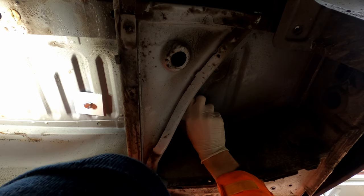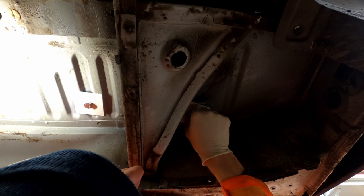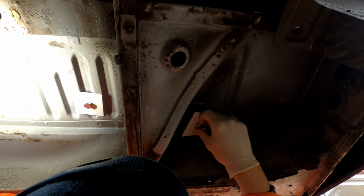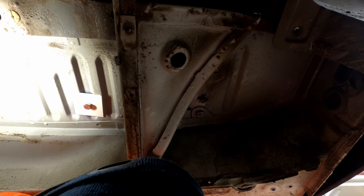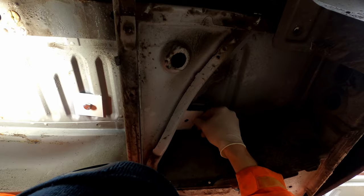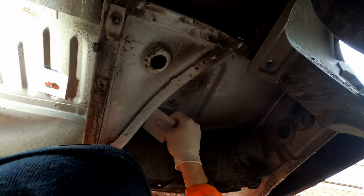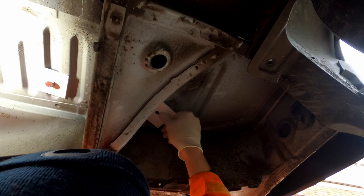So what was he looking for? He was looking for 100 by 100 mil and 4 millimeter thick spreader plates. So you might want to find out with him first before you put your spreader plates in. All it takes is just one phone call or even a text, and it saves you doing the same job twice at a later stage. You can see my spreader plates are white. I gave them two coats of Hammerite paint just to protect them from rust.